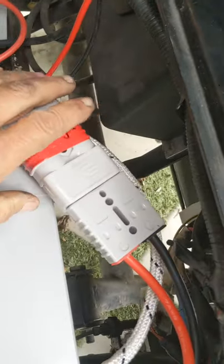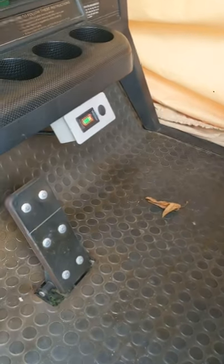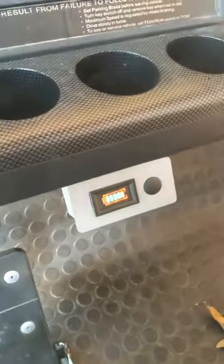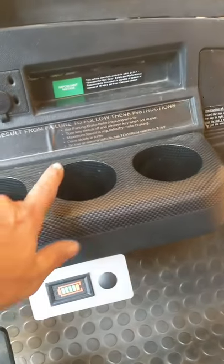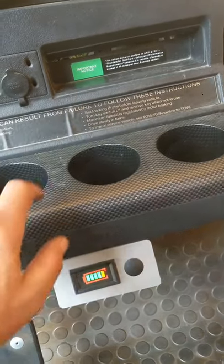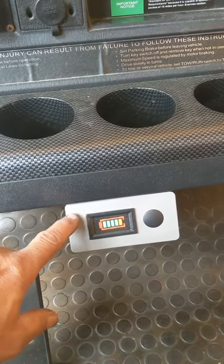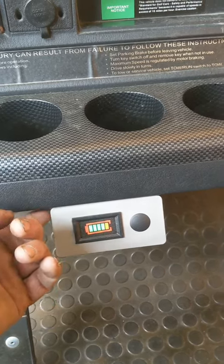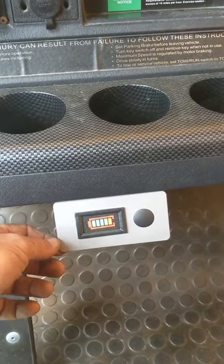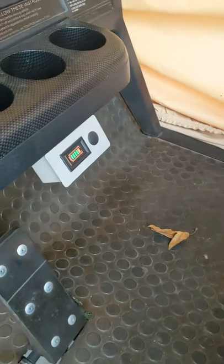As far as the battery indicator gauge — the fuel gauge — we didn't have a lot of choices on where to put it. If I had a little more cable length I would have mounted it up in the dash cavity, but we had just enough cable to reach from the back of the battery. We took the dash apart, put some self-tapping screws in, and that's your fuel gauge.